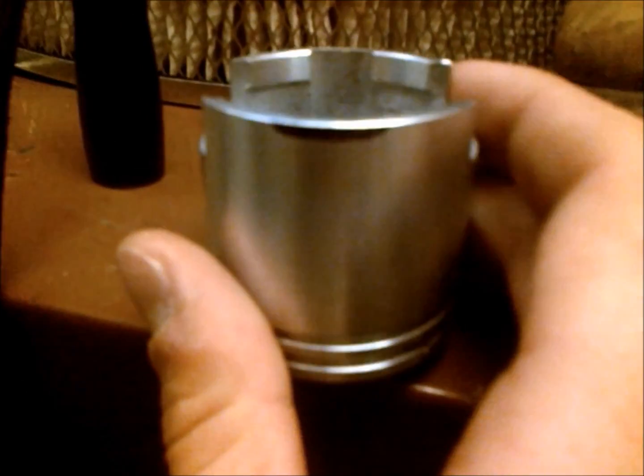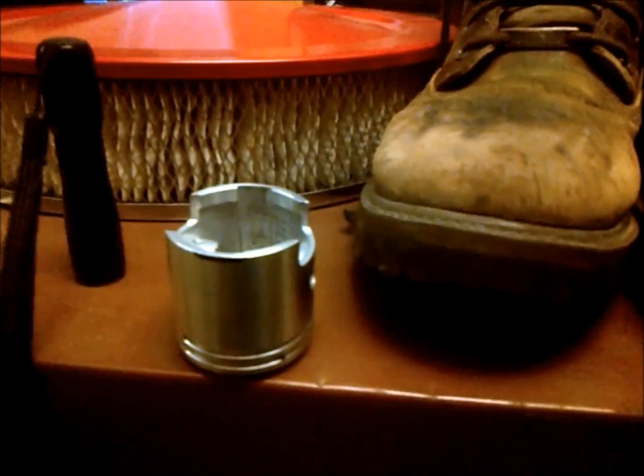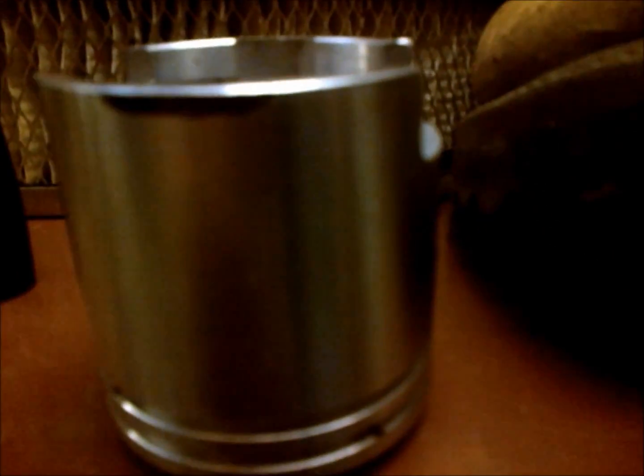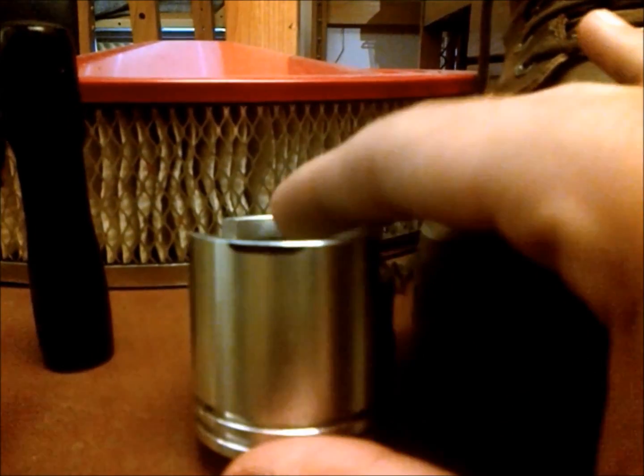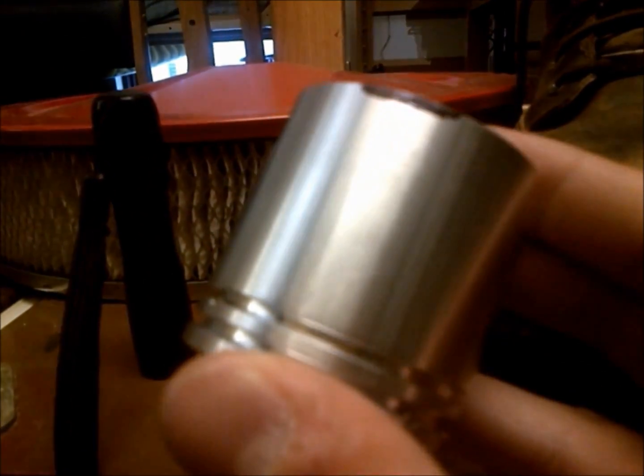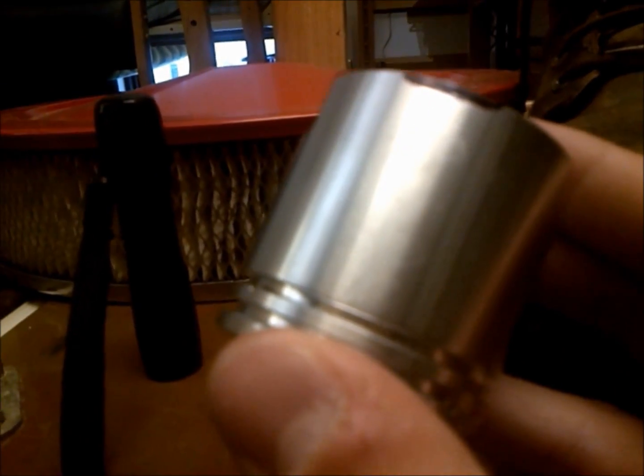port, and considering how big that intake port is, which is only yay big, you know, that's a decent amount when you got a piston turning at 5,000 RPM, so that's pretty fast, and that limits some of the flow. So before I reinstall this, I'm going to go ahead and grind it out.